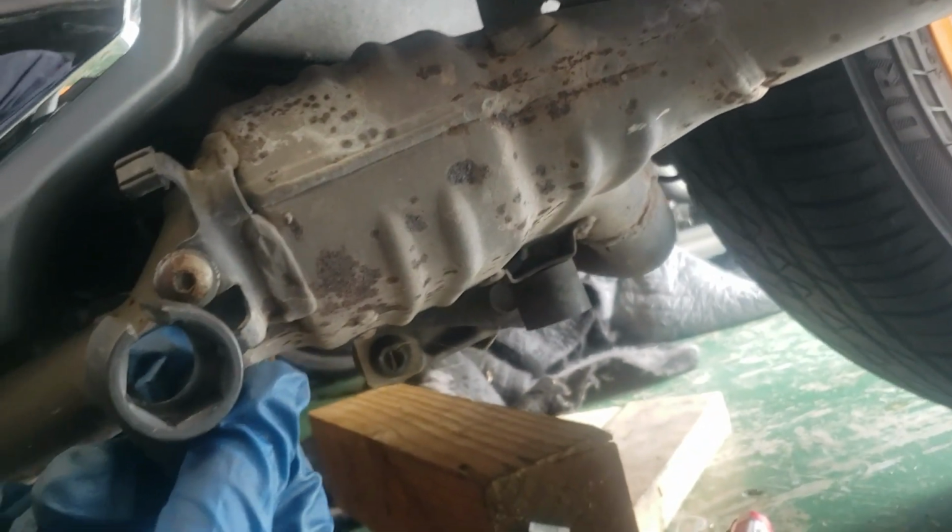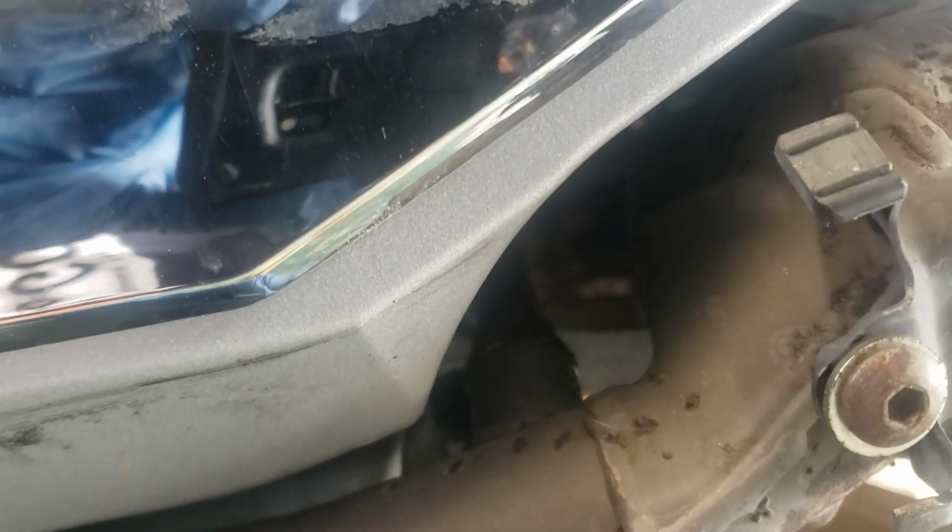An O2 sensor too. This is a Honda Goldwing GL1800 2007. Getting this O2 sensor in from the bottom to release the tension off the O2 sensor in the tailpipe. I found the best way was to slide up under the bike and around the wire.